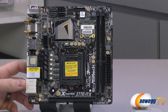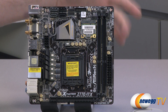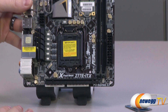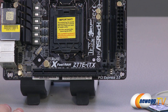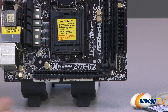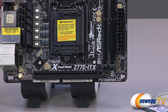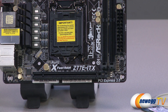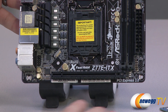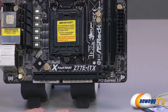Now let's take a closer look at this motherboard. As mentioned, it is a Mini-ITX form factor — it measures just shy of 7 inches by 7 inches. Starting from the bottom, we have a full-length PCI Express X16 slot. If you're looking at a Mini-ITX motherboard, there's a fair chance you're building a smaller system — great for home theater PCs. But with this full-length X16 PCIe slot, fully Gen 3 compatible with Ivy Bridge, you can easily add a discrete graphics card and build a nice, powerful Mini-ITX gaming system. There's also a front panel audio connector and front panel power and reset headers to connect your power and reset buttons and LEDs.